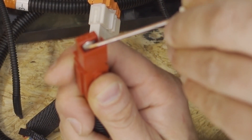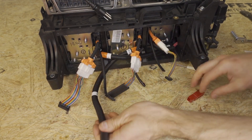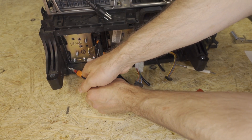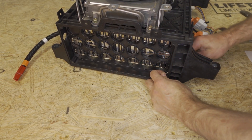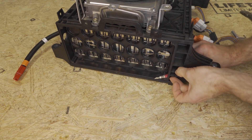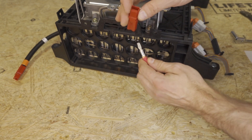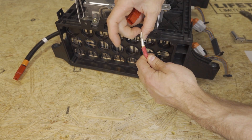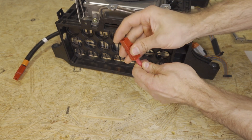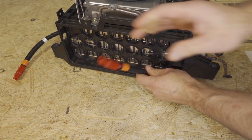There is a metal tab underneath the connector, and once you push down it'll let you pull it over — you can see how this metal tab holds onto the back of this connector at this lip. With that connector off, without touching this connector to the battery enclosures, we're going to slide through this hole and then through the hole immediately next to it as well. Route the cable and jacket all the way through. Then reattach the connector cover — the side with the lip on the bottom goes on the same side as the metal. If you put it on backwards, it won't even try to fit. Make sure it's snapped all the way in; you should be able to pull on the Anderson connector and it won't come back off.